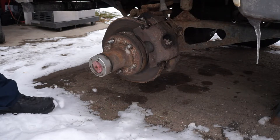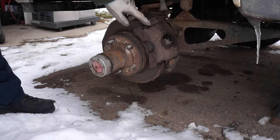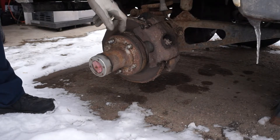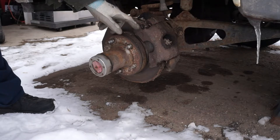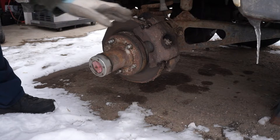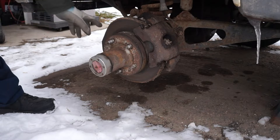The first thing we're going to do is remove the brake caliper by driving out the two retaining slide pins. There's one here and one down here. These are a Ford-style setup for these older Fords — you've got to depress this side a little bit and then drive it through with a hammer or some sort of punch in order to get those out. There are no bolts that hold the caliper on; they're all part of a slide mechanism.